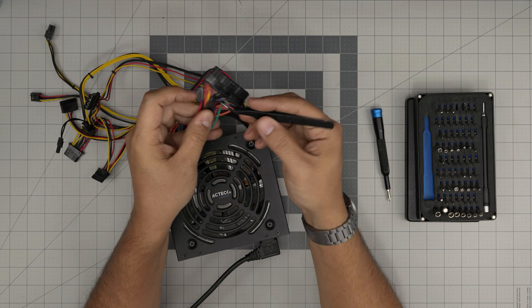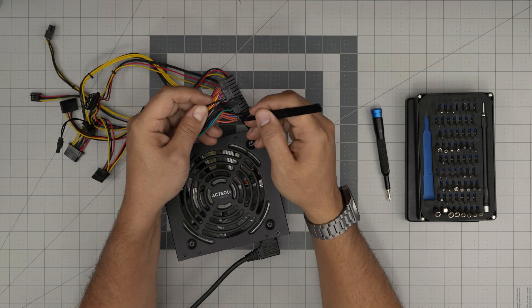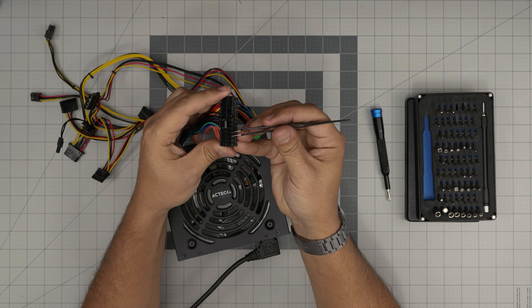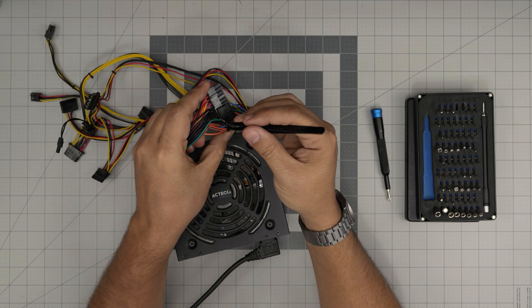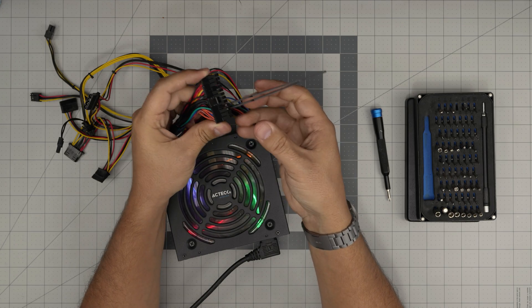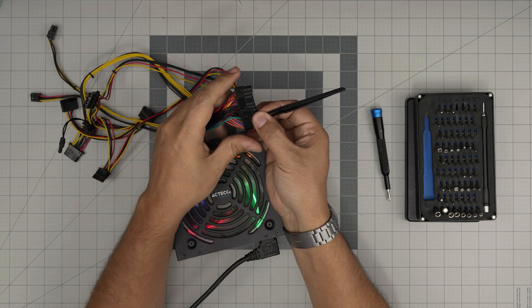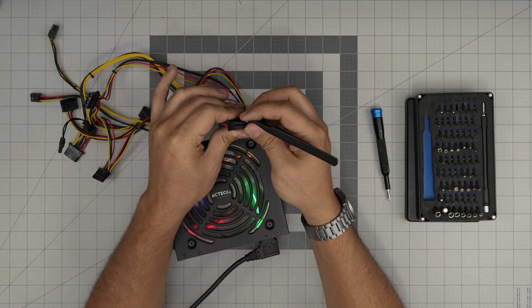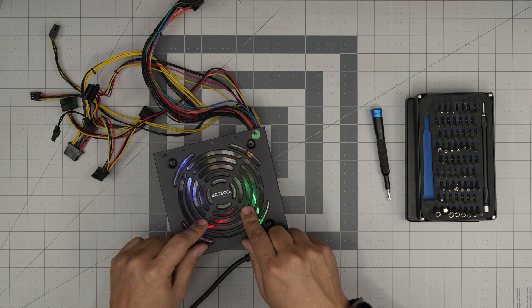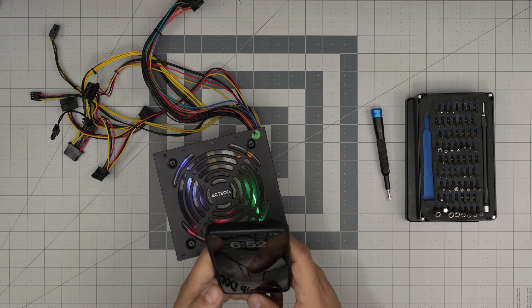Find the green cable on the 24-pin connector. Beside it there are black cables on the left and right side. You want to short the pin on the green one with any neighboring cable — either the left or the right one. Just put it in there and the power supply will start working. The 12V side cannot give you any shock, so it's safe to work there. Right now my microphone is not picking it up, but it has a really nice grinding noise — I'm going to record it with my phone.